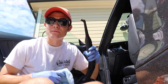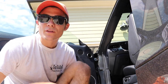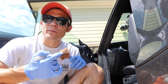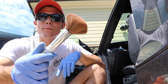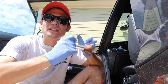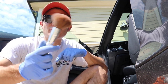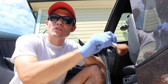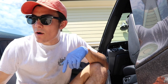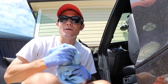In this case, I'm actually not going to use the toothbrush at all. Literally the only things I'm using are my microfiber towel, my Super Clean degreaser diluted five to one, and my VX5000 steam cleaner. The only other thing you might want to use for a regularly maintained door jamb is a really soft makeup brush — you could spray the degreaser and agitate it with the makeup brush, which is very soft and won't scratch any paint.